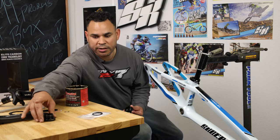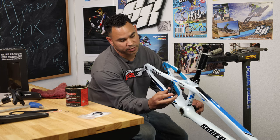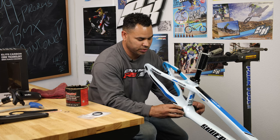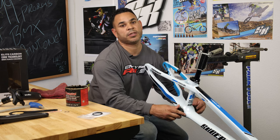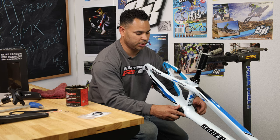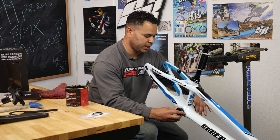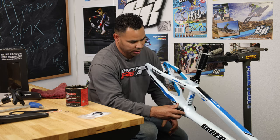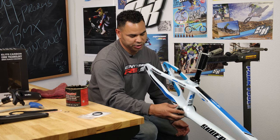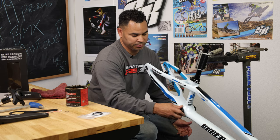So we're going to go ahead and start with our bottom bracket. These cranks do come with a nice sturdy ceramic bottom bracket. These are labeled left and right — if you look right here on the casing of the bearing, it's going to have an R and it also has a tightened direction. More often than not, a lot of people don't realize that bottom brackets are threaded backwards. They're both actually going to thread the same way, so it's a little different than a normal thing. Just make sure you pay attention to those little indicators and that'll make sure you have a nice smooth install. It should go pretty smooth by hand. If you do have any issues, you can always wipe off a little bit of that extra grease, make sure that interface is nice and clean. If you have to grab a wrench, I'd recommend you clean up those threads a little bit more — just make sure you're not damaging the frame.